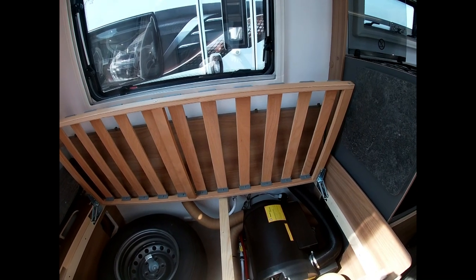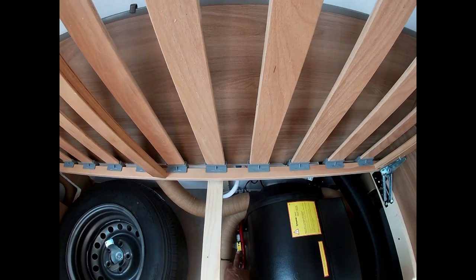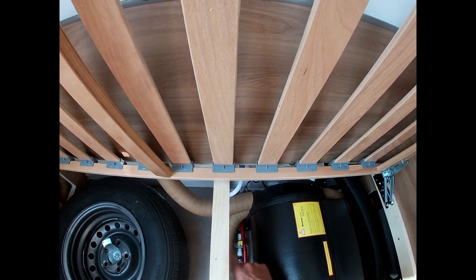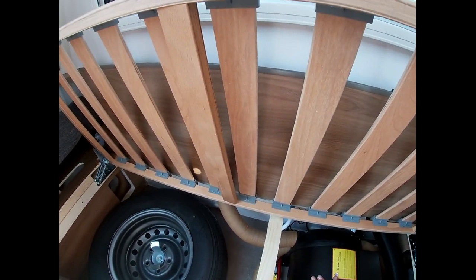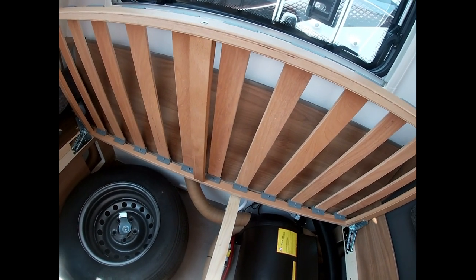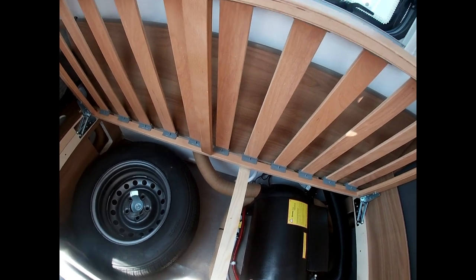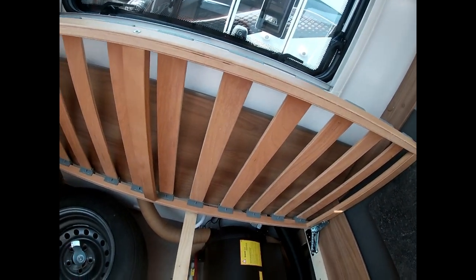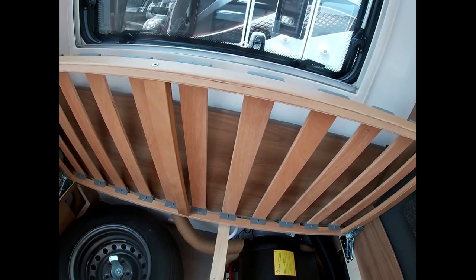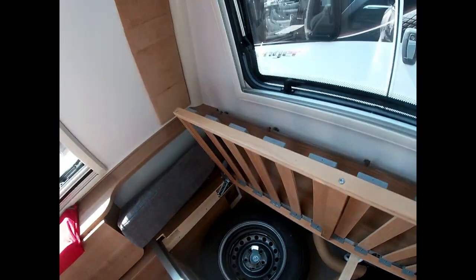It again is of paramount importance that the yellow lever just there like so, yep, that's our drain lever, drain valve, to drain this boiler down. We must do that in the winter. In the vertical upright position like so, it drains the water to ground. Parallel across the van, like so, it's closed. Okay, so we will drain this down at the very end and discuss it all, but that's your boiler, works on gas and or electric, and it's sat just under the seat down there.